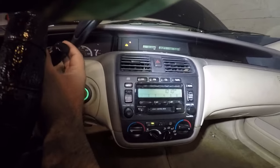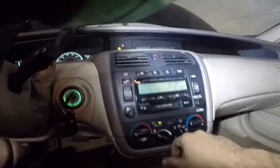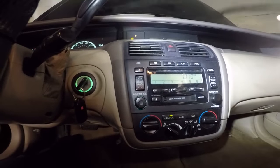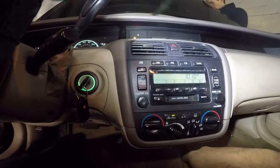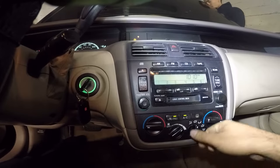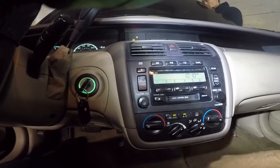So let's put on a couple of accessories. We've got the wipers running, we're going to put the headlights on - this is sucking a lot of power. I know what's going on here - it's going to put load on the alternator which is going to cause the belt to slip. Maybe the belt is bad or the belt is loose. So next, let's kick in the AC blower motor and turn the AC off and on.